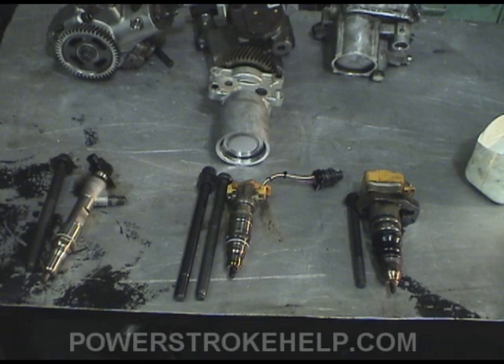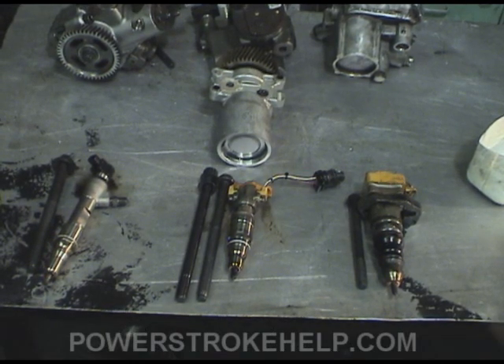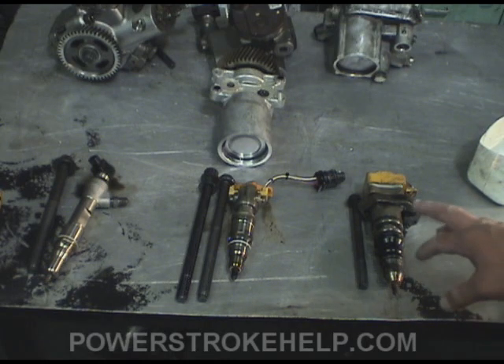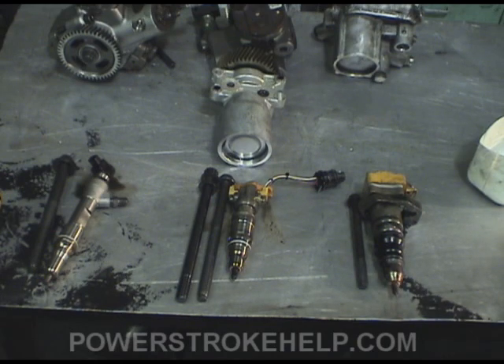The things that have changed over time are fuel injectors. The 7.3 fuel injector — the old CAT-style HEUI system — is state of the art; it's indestructible. You can pass small pebbles through this fuel injector and it will still run. Of course it has a negative effect with water getting to it, especially if you let it sit, but for the most part these injectors live through things that they shouldn't have.